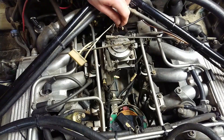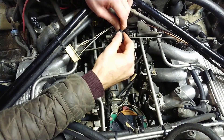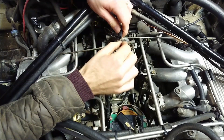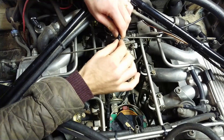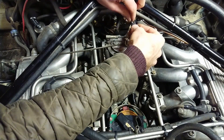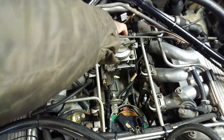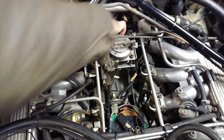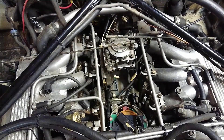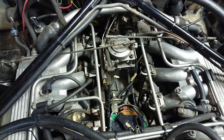Now the other side is soldered on as well and shrink wrapped. Take the four-way connector and connect everything back up into it — make sure it goes all the way in. Then lastly, connect up the 12 volts to the trigger board and plug it back into the ballast resistor. Tidy up the wiring a bit and that's all back together. Now you can put the distributor cap back on, reconnect the HT leads, reconnect the battery, start up the car, go for a nice test drive, and be happy knowing that you've made your car a little bit more reliable.